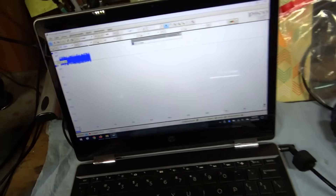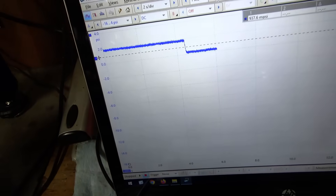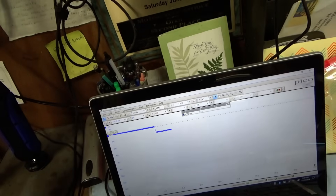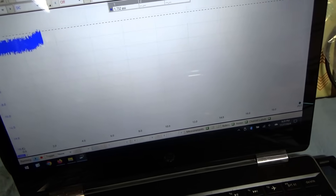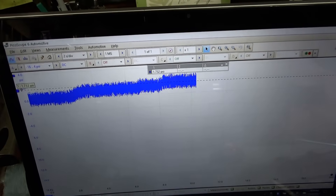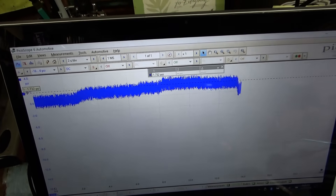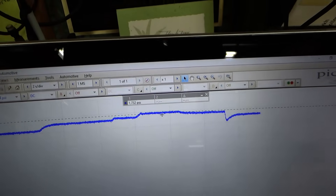In smoke mode it's about 2 PSI, and in air mode it's about 1 PSI. So very good — it's regulated. The unit has both a smoke mode for leak checking and an air-only mode for finding the size of your leak where the flow gauge works. Now let's try it on the headlight.